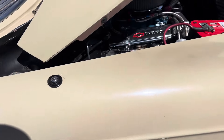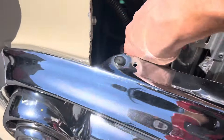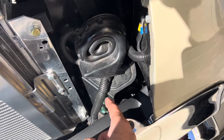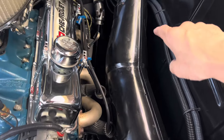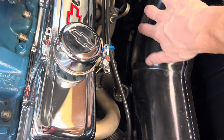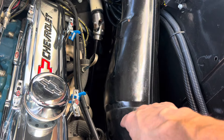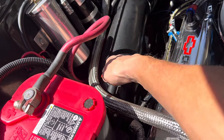What I was going to do in the Gullwing — though he didn't like the price — the Gullwing had the same kind of fresh air delivery system that came right off the front. You see the openings right down in here? There's a big giant opening there and another big giant opening right there. So I was going to put computer fans or a single fan blowing at pretty high speed, adjustable so I could turn it down to the required amount. With a ton-and-a-half evaporator from a little Prius — the evaporator is just a little bigger than a man's hand — right inside here with some sheet metal modification, I could make a Prius evaporator fit down inside here.